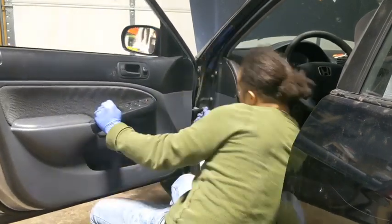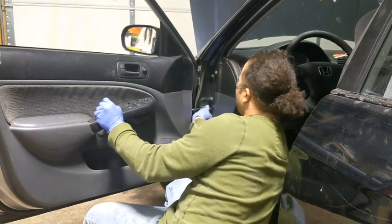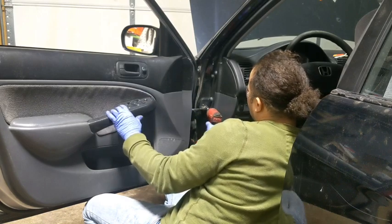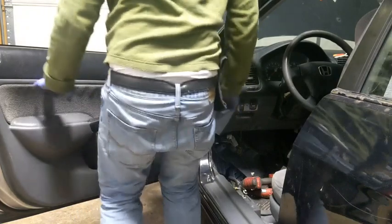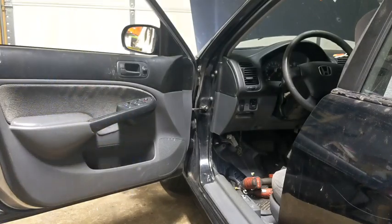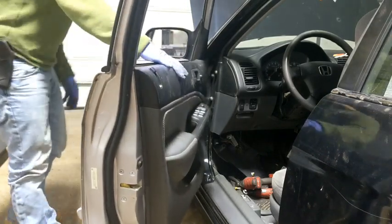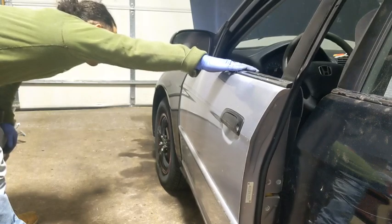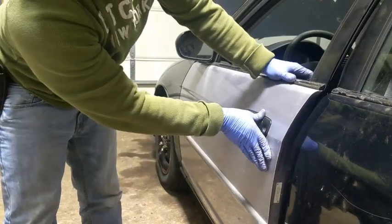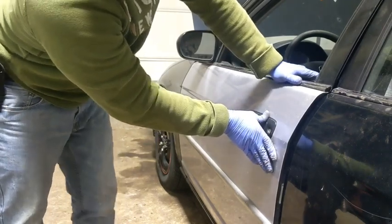I'm gonna close the door a little bit to put this one. This one has a little stop — it has a little nipple that goes inside the hole. I'm gonna get my drill. Now it's moment of truth — when you do this, don't slap the door right away. Go really slow, because you don't know if the fender is gonna touch or the door is gonna be overlapping the other one. So I'm gonna go real slow and make sure everything is lining up good. Then I come over here and kind of bring it in by hand. Everything looks good.